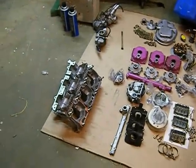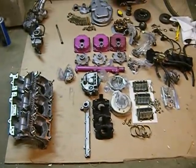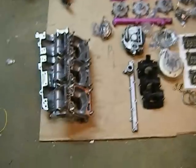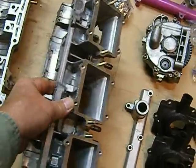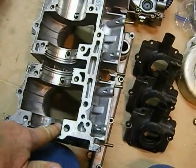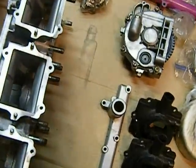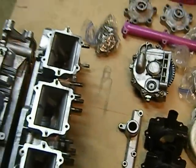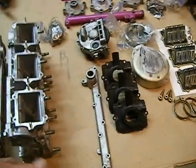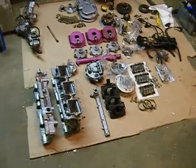These Fuji engines are really good engines, but they're really delicate — everything has to be just so, or they'll come apart quickly. This particular engine does not have a bearing that is oiled by the oil injection, which means I can mix my oil and gas. On some Fuji engines I've seen, they have a line going to the bearing, and you better keep your oil injection. But this particular engine doesn't have that — the bearings are lubricated by the charge coming into the engine, the oil and gas mix.